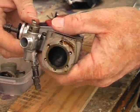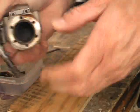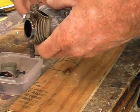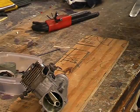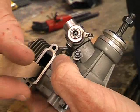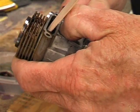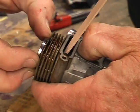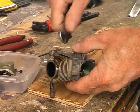Removing the liner can be problematic because over time liners tend to seize inside the motor. If you can't pull it with your fingers, the first alternative is to put a foreign object in the exhaust port — but only use something soft. I use a lollipop stick, carve it down, stick it in the exhaust port, then when you turn the crankshaft at the front the liner should pop up, giving you enough room to get your fingers in underneath.